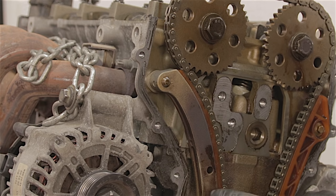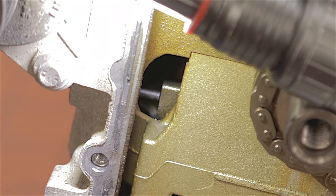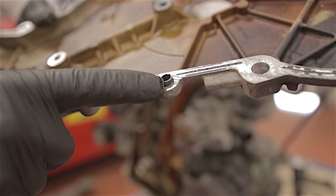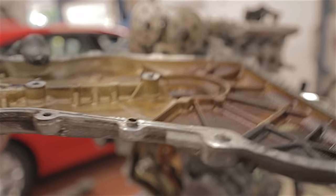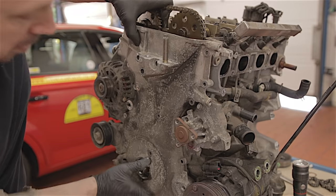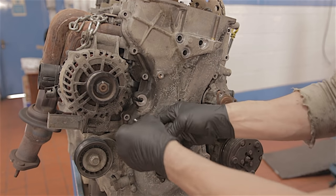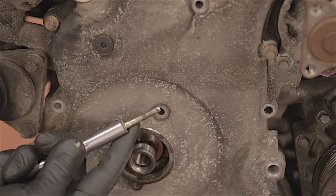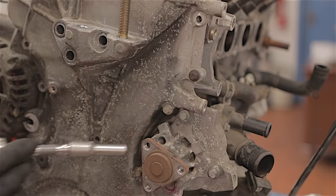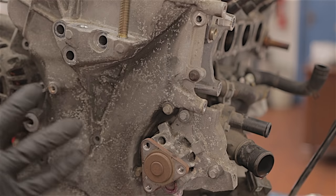You can assume that I've cleaned up all the surfaces where the casing's going to bolt up, and I'll put a thin bead of black silicone sealant all the way around. Our camshaft setting bar is in place and our crankshaft pin is butted up against our crankshaft. We'll refit the casing — just note there are a couple of little dowels, one either side, which makes things easier. Now it's just a case of refitting all these little 8mm bolts all the way around your casing. Remember, one of these bolts is longer than all the rest and sits just above the crankshaft. I'd go around them probably three or four times to make sure they're all done up evenly.